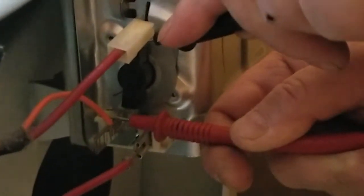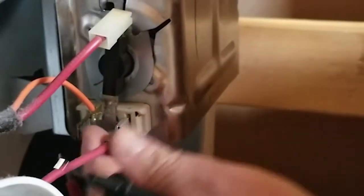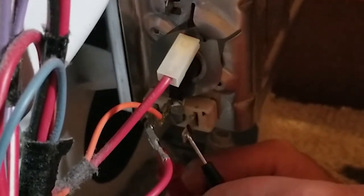Down here, this cutoff is actually directly connected to the heating element, so we're going to do a few tests to check it. This is checking the high temp — and that's good. Now let's come down here and see if we get continuity on the heater. The heating element will have some small resistance, but it's showing continuity. If that were open, that might be the cause if your dryer is running but not heating the clothes — that's a good spot to check.